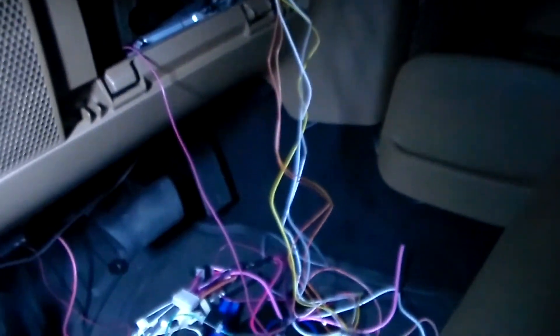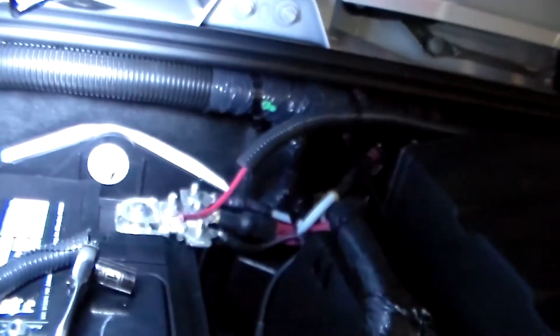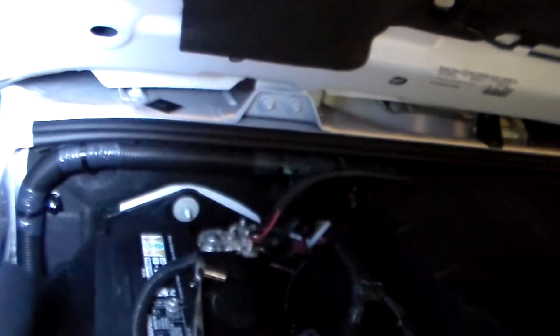Now people, we're in the thick of it here. Almost everything is hooked up. Had to hook up the parking lights over in the passenger kick panel, and of course that wire is going to be tied up — you won't see it at all when I'm finished with it. I had to run a couple of wires under the hood, one for the horn and the other one, because they recommend constant power is hooked up at the actual battery itself. So you see all the stuff taken apart now, but soon it'll be all put back together again. Wire loom is looking nice and neat, run along with the factory. Just got to cut the ends of the zip ties off, then I'm going to terminate it and connect it right to the battery right here. Nice and neat. Nice and professional. Every time.